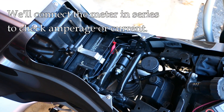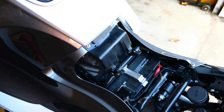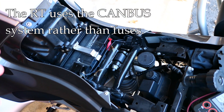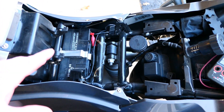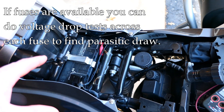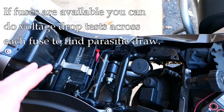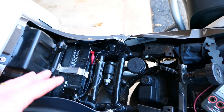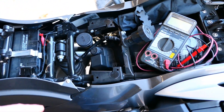I'm doing this testing on a BMW R1200RT. A lot of these newer bikes do not use fuses in the electrical system, and this complicates testing. In the old days you could test across the fuses in a car or a bike — you could test for a voltage drop across a fuse, check that against a chart, and that would tell you how much electricity is being drawn by a particular circuit.